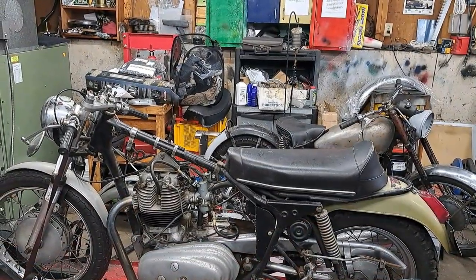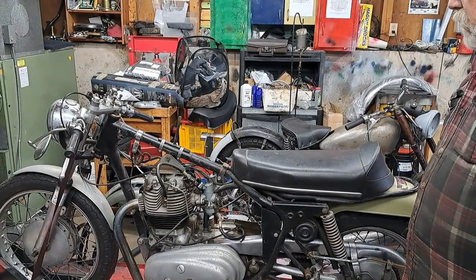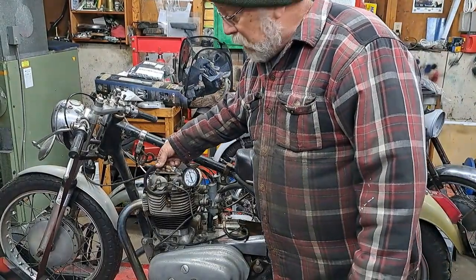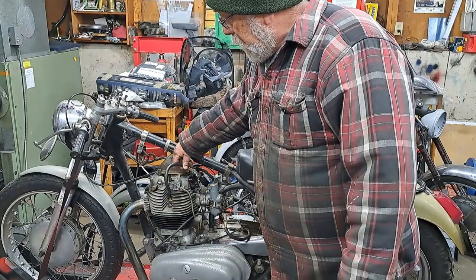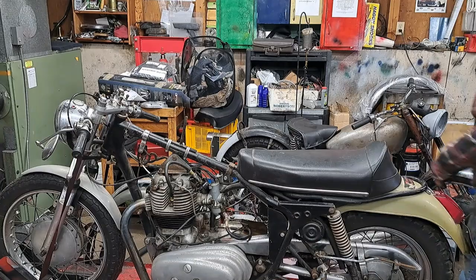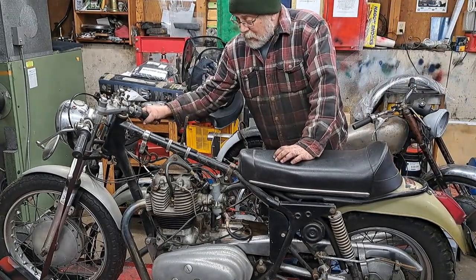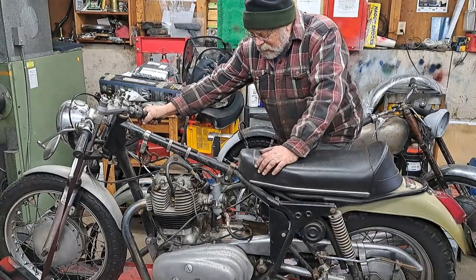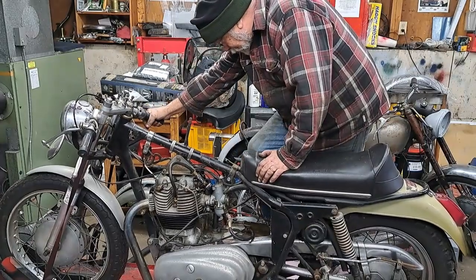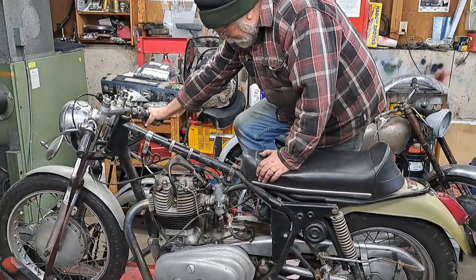Okay, tap on those valves to make sure they were actually seated home on the seats. So now, as you can see, tucked away in there between the carburetors, I've got that little compression gauge in there. So I'm going to twist the throttle wide open and jump up and down on this pedal and see what kind of compression this thing's got. Oh, I did oil the cylinders, by the way, just some light oil. Better than it did. All right.